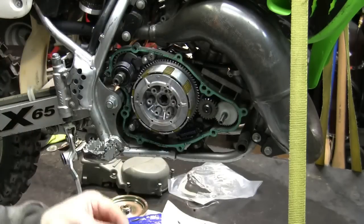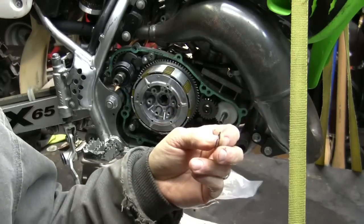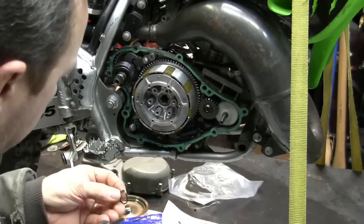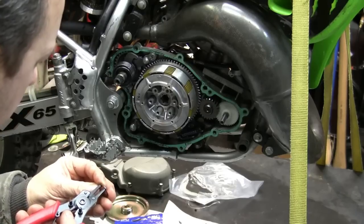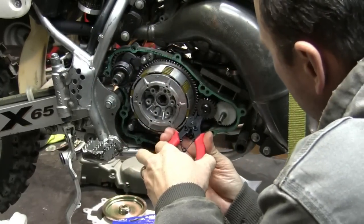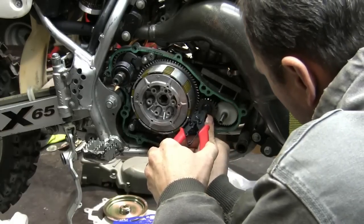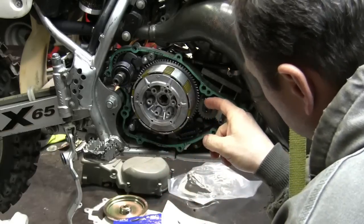Okay. Next, circlip. Snap ring pliers. A tip for that when you're doing them, always put your finger on it. Let's try to do this while I'm out of your way here. But put your finger on it so that way it doesn't go flying off. I like to seat the bottom. Just give it a little spread so it goes over the top. It's right on there, man.